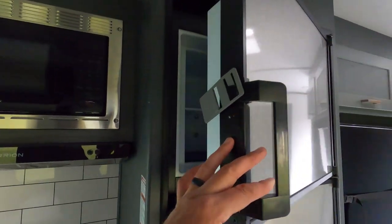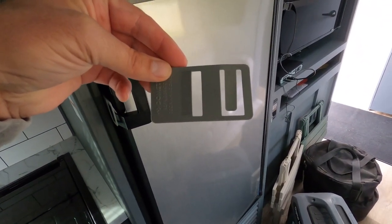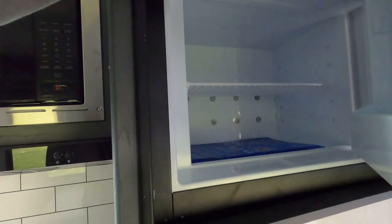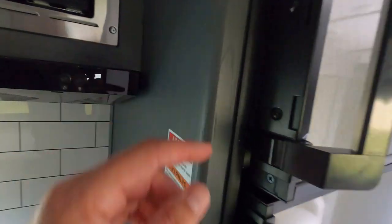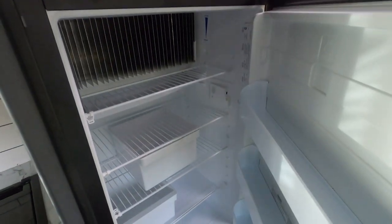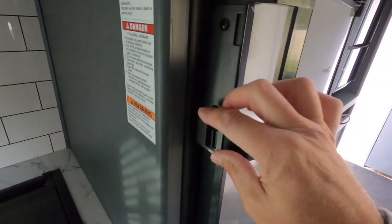One thing people don't think or associate with winterizing their trailer is their fridge and their freezer. Now, we have these little clips that came with our trailer, but you probably order them on Amazon. They just hook right here on your trailer. Make sure it's off. Okay, so here we are, we're off. You're going to close it just to where that's going to prevent it from closing all the way. It does keep a little bit of an opening there, so that way it doesn't get moldy and stale in there. You just clip right on there. You got to hold them until it closes.